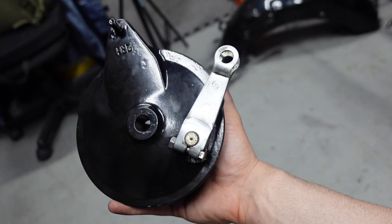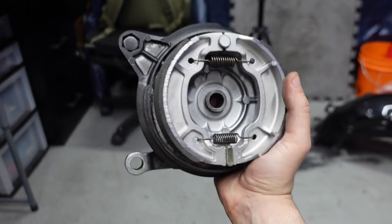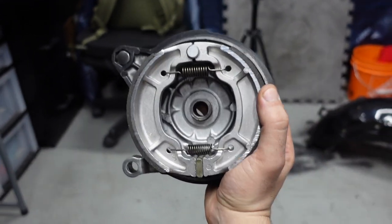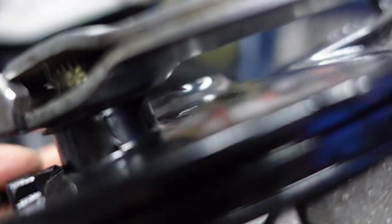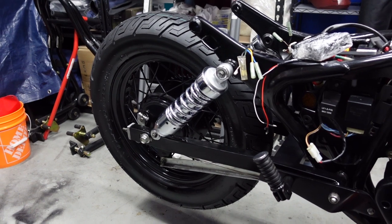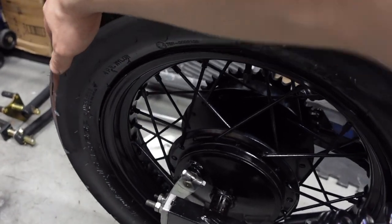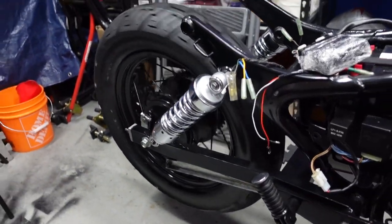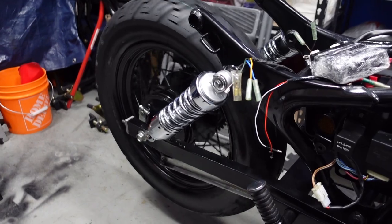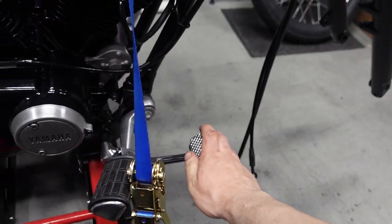I got the brake lever on the brake shoe cover and installed the new brake shoes. I matched the angle it originally was when I took it off, so everything lined up really well — good thing I took footage and pictures. Don't forget the tab underneath — it also needs to line up with the direction of the lever. The wheel is installed, everything's hooked up. Testing the brakes: really nice and smooth, no grinding, brakes don't make contact until I press the lever. The tension on the lever is really smooth. Perfect.